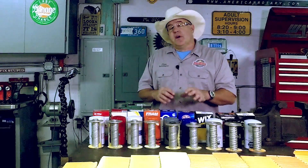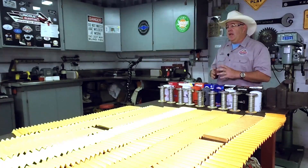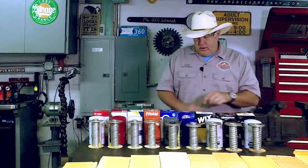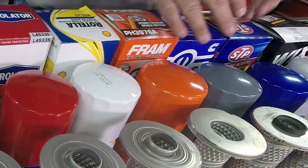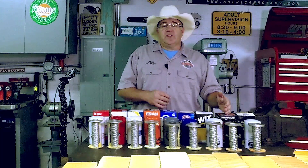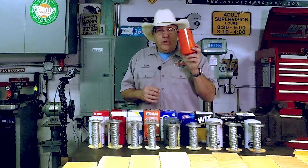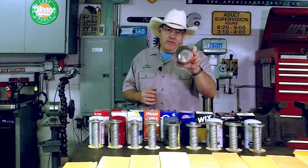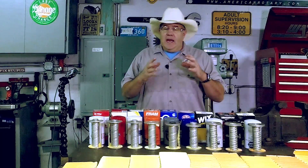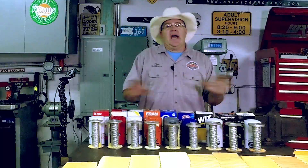The STP filter appears to be very closely related to the Purolator, Rotella, and CarQuest, however it contains a lot more filter media — pretty close, honestly, to the Wix/Napa/MicroGuard group. Pretty good bang for your buck. Now the Fram filter had a lot of filter media in it, really about the same amount as the Napa Gold and the Wix filter, and I was going to give this filter a pretty high score until I saw something that put me on the brakes. When you look inside this can, there's rust. The inside of this filter is rusted. In a previous video on automotive filters I consistently found rust inside the filter can among three Fram filters. Folks, completely unacceptable. Because of those findings, I've got to take the Fram filter completely out of the race — there's no reason any rust particulate should ever be floating around in the oil inside your engine.